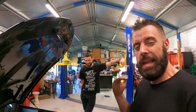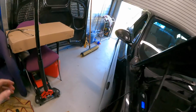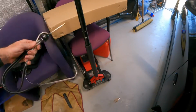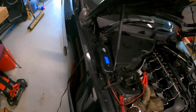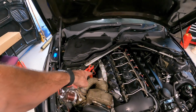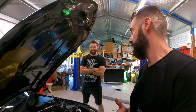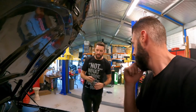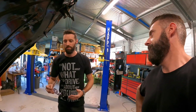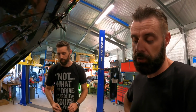So yeah, it appears to be louder underneath the engine. We went through the whole motor, touching all the metal points that we can with the stethoscope, and you can't really hear the tick at the top of the engine. You can hear it a little bit on the manifold, but we think it's an exhaust leak. The word tick is sort of generous. It's more of a flutter. Yeah, so maybe it's exhaust.